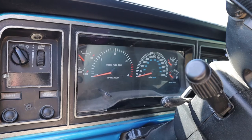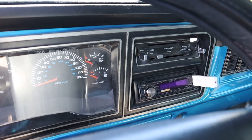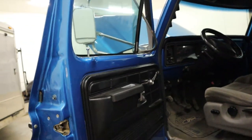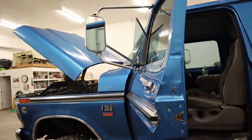Gauge clusters — Dodge. Headlight switch. But I've incorporated the heater — it's actually the Ford controls. So does the heater and the AC work? No air conditioner. The Dodge had air conditioning, but when I moved the engine back, the AC compressor — the crossover member on the frame ran right into it. So I pulled the pump off. In hindsight, what I'd do is notch that frame and make that pump work. So your AC is four windows down, 60 miles an hour.